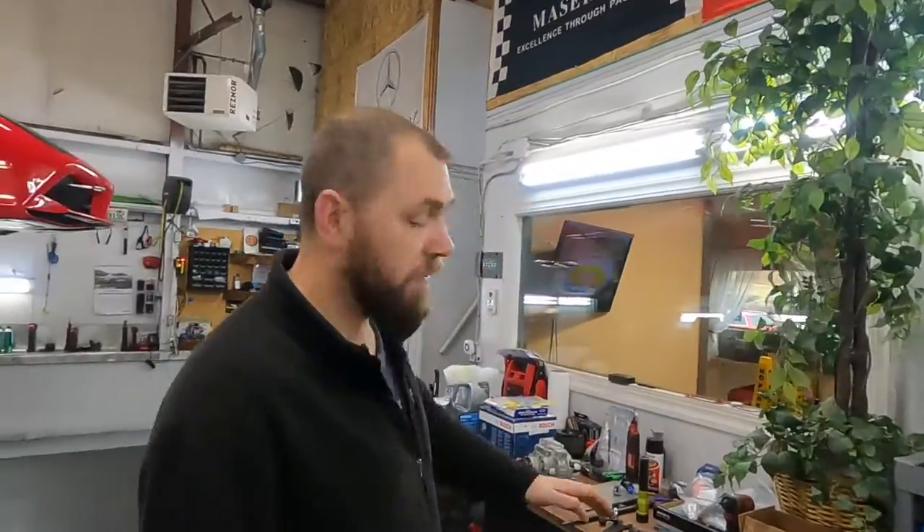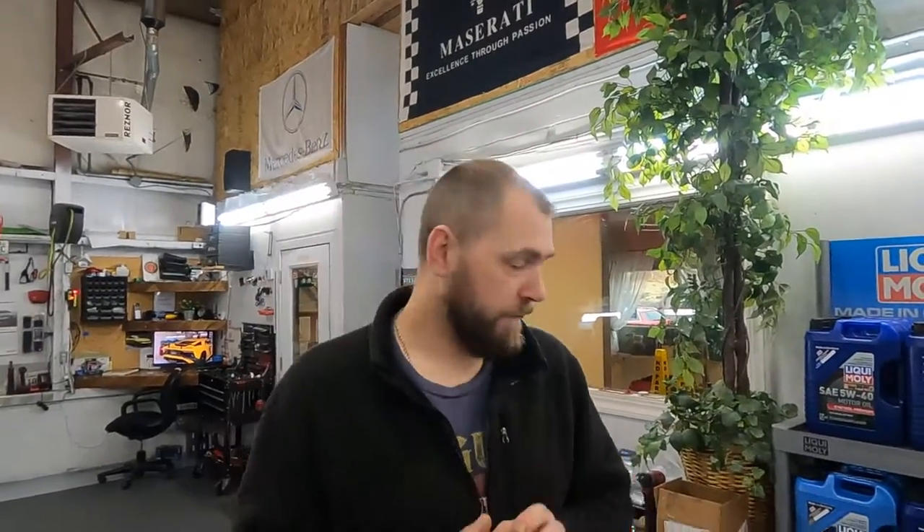Last time we posted how to recharge the AC system — we did that — and there's still no AC on this car. We checked again and again and diagnosed the issue. It's actually a problem with the AC compressor. We got a new AC compressor; I already installed it. I didn't film the beginning because I started work on this car last Saturday.